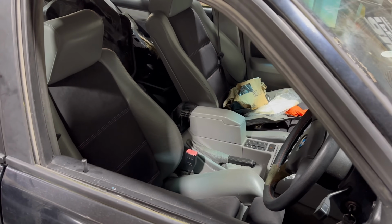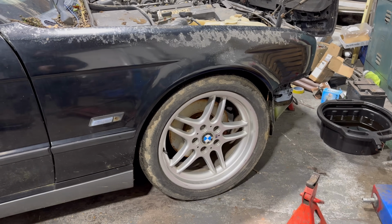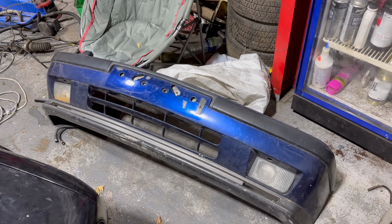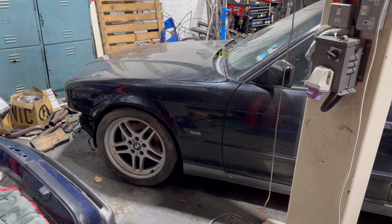We've put that fuel through the original lines and original fuel filter, and as we saw in a previous video, the fuel lines aren't very nice. So they could have potentially dragged a tiny particle of rust through the line up into the injector and blocked one of the injectors, and that could be the main reason for the misfire.